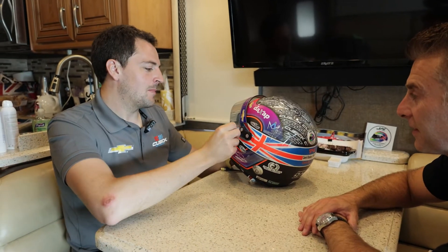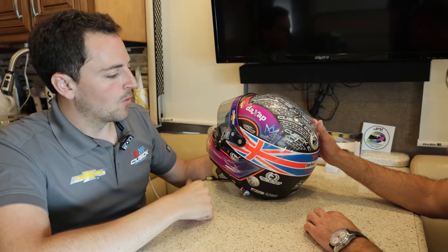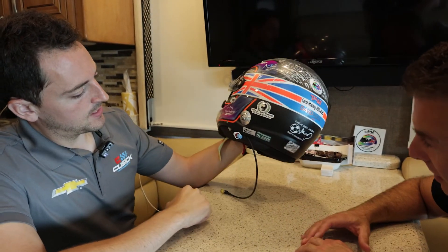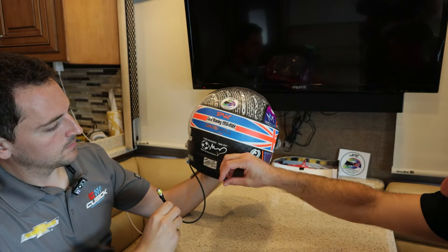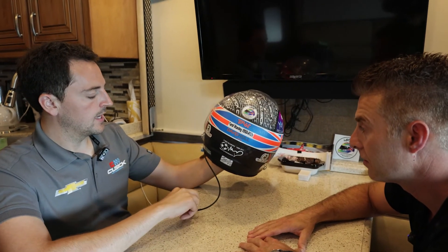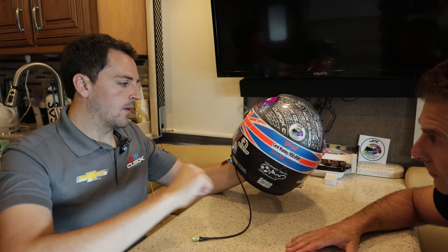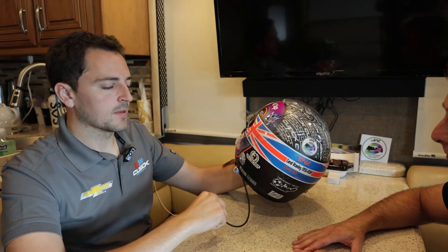Now the tear offs are mainly there just in case something comes through the vents and gets onto the visor — you've got one or two, but it's not as important. More importantly, there are tear offs on the aero screen itself now. We've got the HANS clips, which obviously clip onto the head and neck safety system. There's also the eject system — the safety crew can push air through that to push the helmet off the driver's head slightly using a bag installed on the inside. And then of course the radio cord, which connects to the earpieces. The earpiece loom goes through the driver's suit and connects to the car.